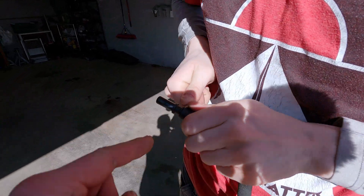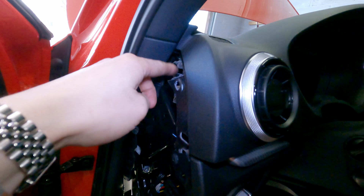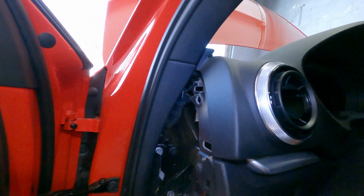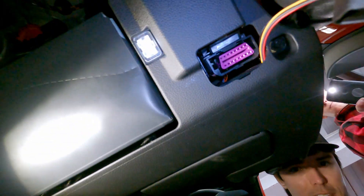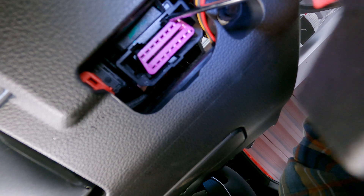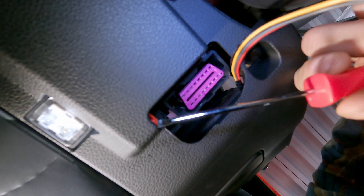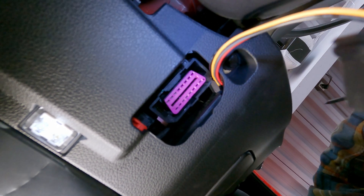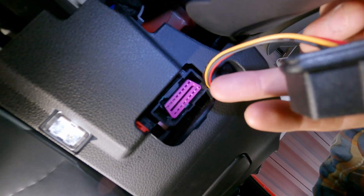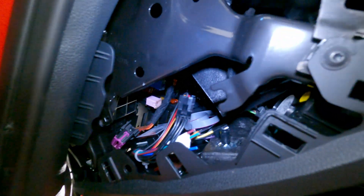One that we're repurposing here. For the OBD2 port, you can pop this side panel off — use the trim tool. There are maybe three or four clips. On the bottom side of the OBD2 port there are three little clips — two on the back side and one on the front. If you just use a small screwdriver like this to press up on there while also putting a little bit of force on the actual connector, you can get it to pop up and out. And then you should be able to just wiggle it free there.